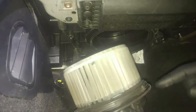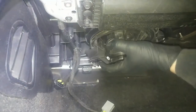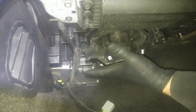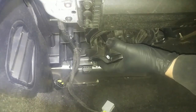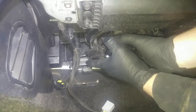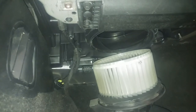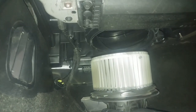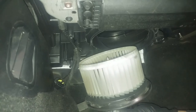Those are little tangs for locking it in place, so you can just put it back up and turn it back into place. Boom, boom — back in. A little tricky. I'm going to leave this out while I do some cleaning, then put this piece back in, plug things back together, put your shield up, and that is replacing your blower motor on your 2016 Ford Explorer. You'll find that mouse.